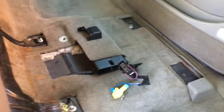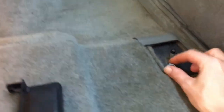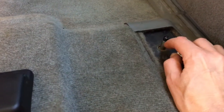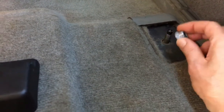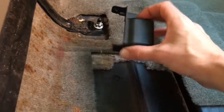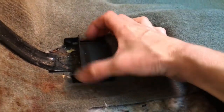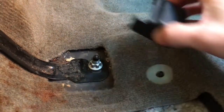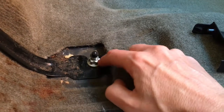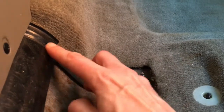And so up here, they're not even actually bolts. These are nuts on the front too, and they've got these threaded posts sticking out, and so that's what you're going to take off of there, and also over here. And then the front one is going to be hiding by this little cap, and so just come in here and pry that off, and that'll give you access to this nut right here. And I have to put the hardware back in because this is actually holding on a piece that is part of the center console here, and so I have to keep that hardware.